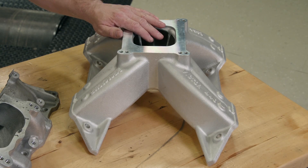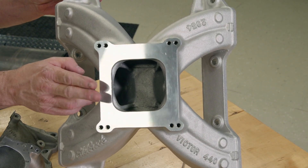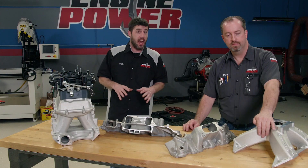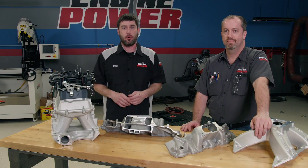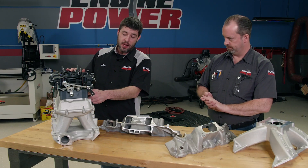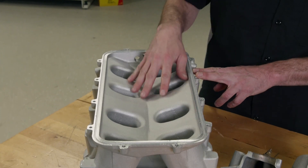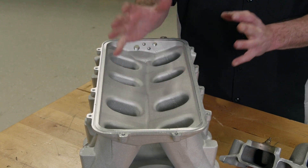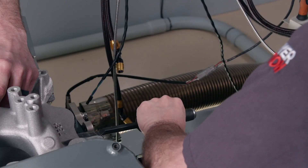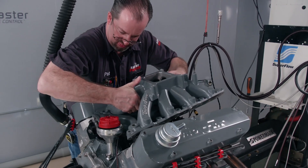A single plane intake manifold has a single open plenum that sees all eight cylinders. A larger cross-sectional area and a deeper plenum allow these manifolds to flow a lot more air than a dual plane — they are designed for more mid to high RPM applications. If hood clearance is not an issue, a tunnel ram is a great choice for performance in a wide RPM range. It's still a single plane design, but its advantage is a straight runner with a clear eye shot from the carburetor all the way down to the intake valve. Depending on runner length and plenum volume, they can be designed to make power virtually anywhere in the RPM range — as low as 4,000 and as high as 10,000 RPM. The difference in dual plane and single plane power was displayed in excellent fashion with our Old Grey Mare 408-inch stroker.